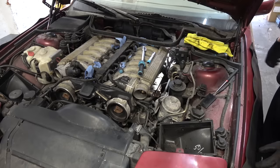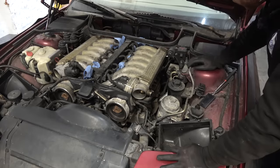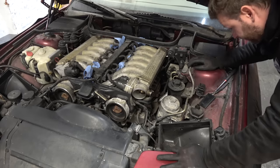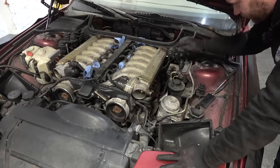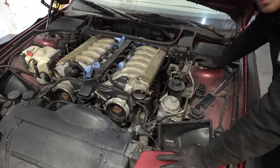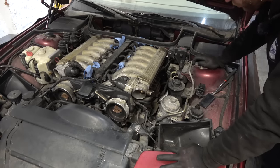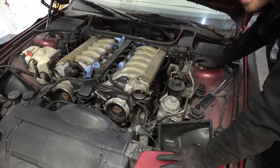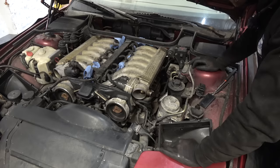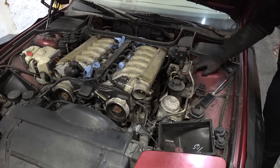This was unexpected and unpleasant. I just ordered a spark plug thread repair kit — it'll come in a couple of days and we'll attempt to fix the stripped threads in cylinders 7, 10, and 11. I've never done anything like that before, but from what I've read it's very much fixable and doesn't look that complicated. First we had fire-damaged MAFs, now this — it always evens out. If we can't fix this, it's a showstopper — bank two is dead without compression.